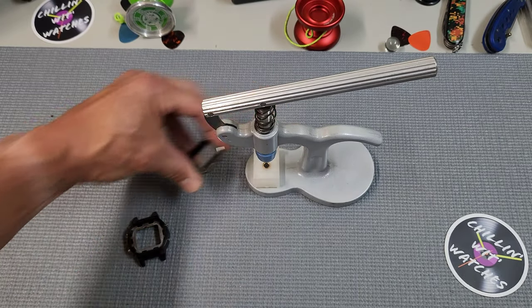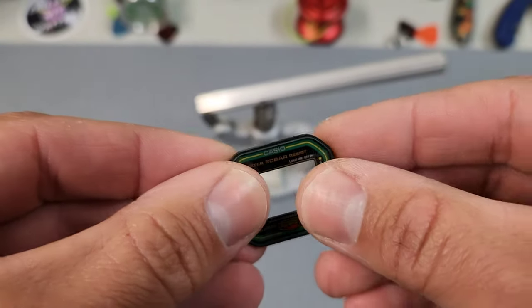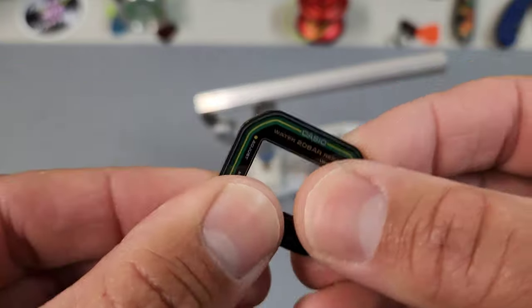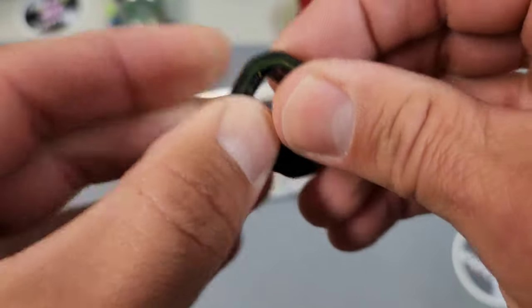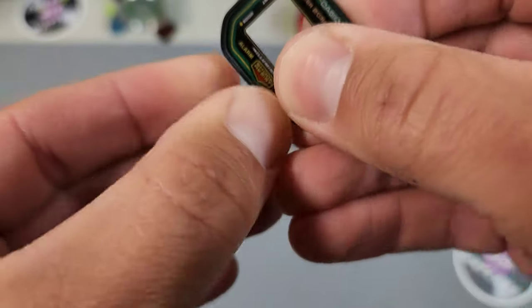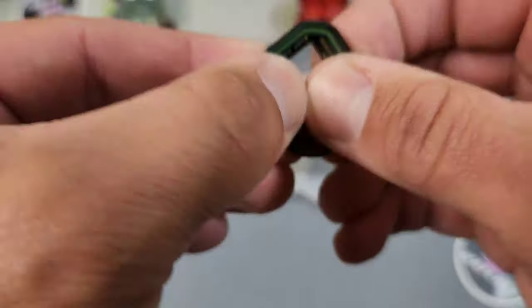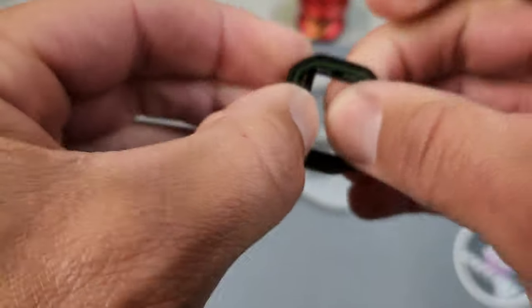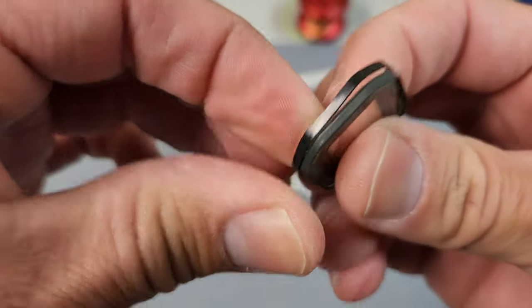The other crystal came out here pretty clean, and you want to make sure there's a gasket around the outside of this that you want to take care not to damage as you're pressing out, because we need to reuse that. So I am slowly working it off of the edge of this crystal. Let's see from the back side. You can see it's coming out there.